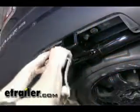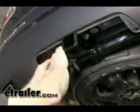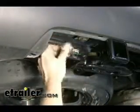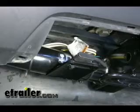The last thing we need to deal with is the extra wire harness from our 4-pole. We're going to take our excess wire harness and zip tie it back to the hitch to take care of any extra slack. Alternately, you could zip tie it to the factory tab here. And with that, that will finish your install of part number 118-434 from TowReady.